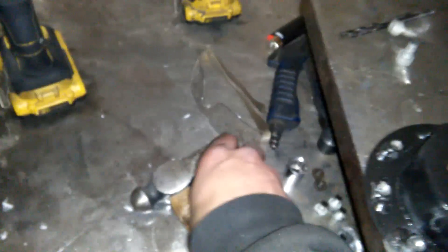If you do need to open up the hole, I'd recommend going to Lowe's and getting a step drill — they're kind of expensive, but if you need to drill a big hole, it makes life real easy. First thing you're going to want to do is take the bolts out of the faceplate, then you need to center punch your holes. Don't try to freehand it — make sure you get a center punch and punch your holes as accurately as possible to ensure a good fit.